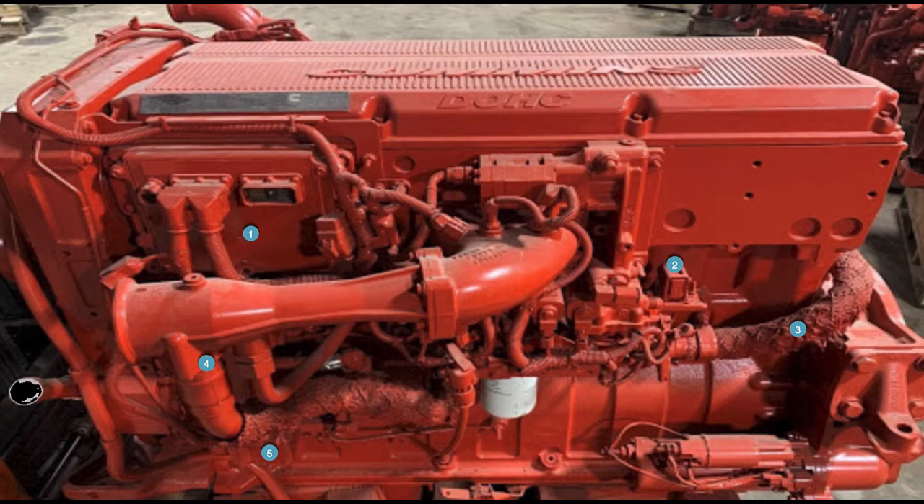Many times only one was used inside the ECM — they're ganged together. So as long as you have sufficient wire current-carrying capability, you could just use one power and one ground going to the square plug, which was on the front top left of the ECM.